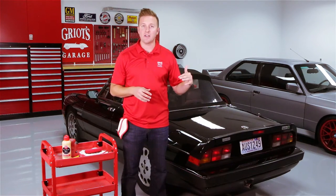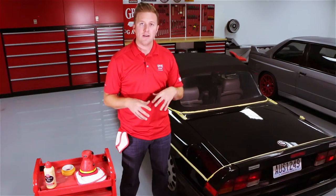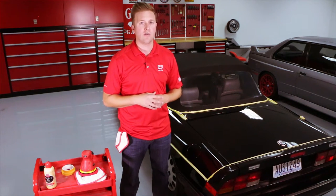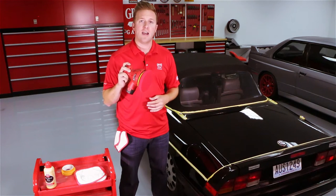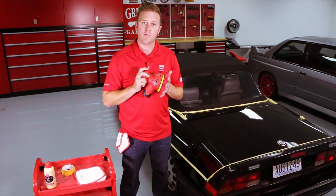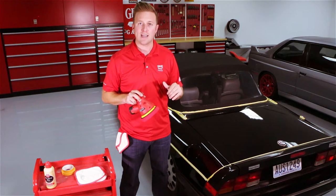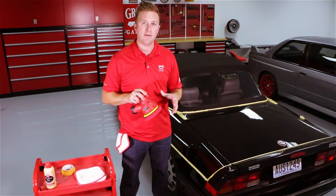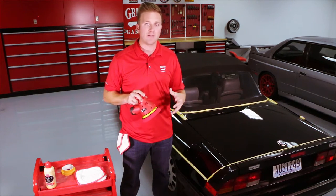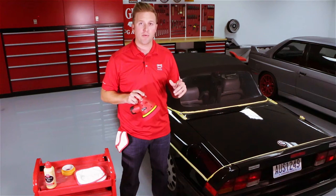Now we're just going to lay it down on this Alfa, showing you a few tips of the trade as we do it. Best of Show Liquid Wax can be applied by hand, but my preferred method is by machine. It can be used with either a 6-inch corded orbital, our 3-inch corded orbital, or my favorite — the little 5-inch lithium-ion orbital. This spins at the exact right speed of about 3,500 orbits per minute. If you're using one of our corded tools, you're going to want to turn it down to a speed two or three for wax application. Any higher speed is going to heat up that wax, make it bond prematurely, make it sticky and hard to remove. So keep that speed low whether you're using a machine or doing it by hand. Just follow some of these simple steps and your process should go very smoothly.